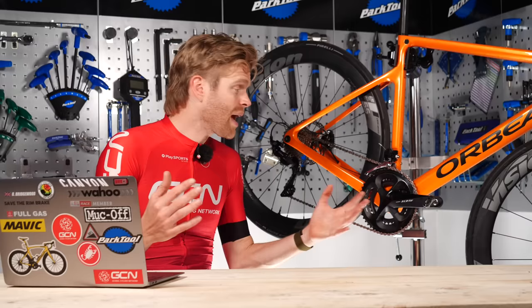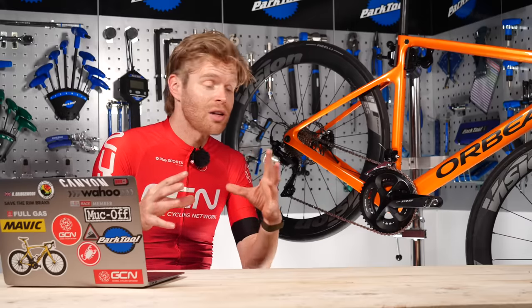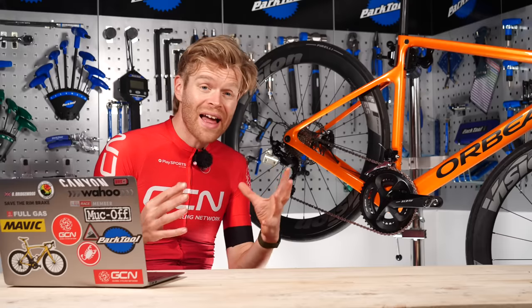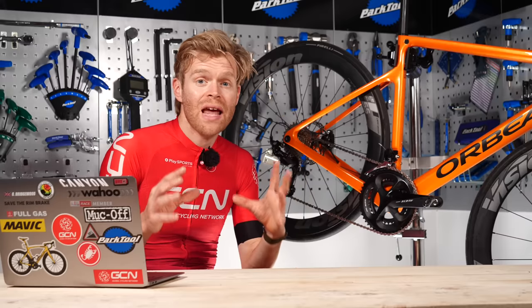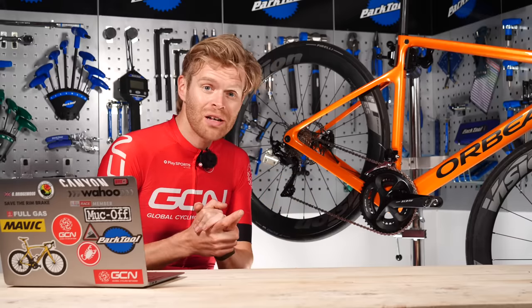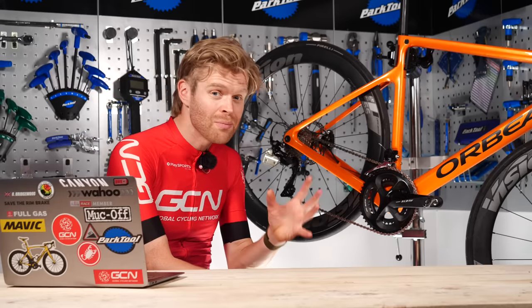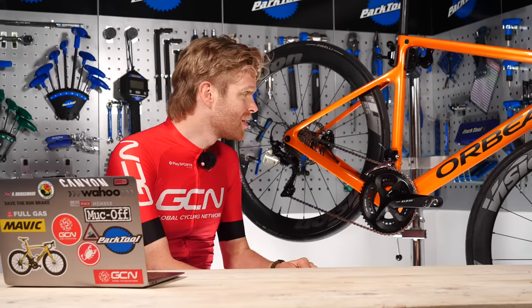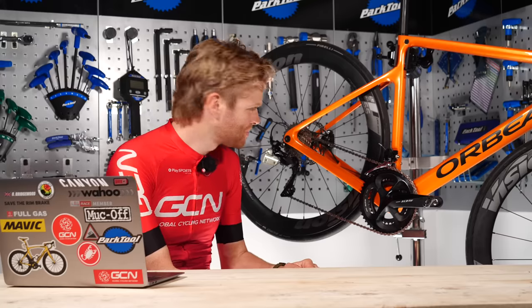And if you were wondering how this compares to the current mechanical Dura-Ace with hydraulic disc brakes, well, that comes in, again, without the cables factored in, at 1,807 grams. So, pretty competitive, I would say, for this 105. You know, it's only 200 grams or so heavier than our Dura-Ace from 10 years ago. That's mad. I thought it'd be more than that.